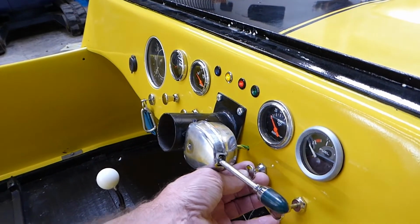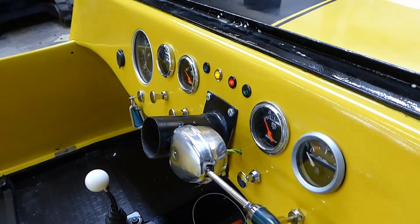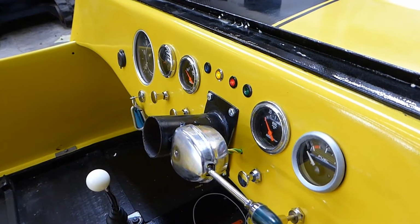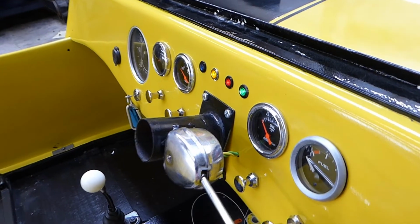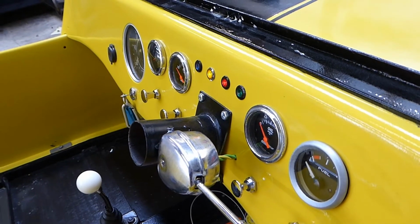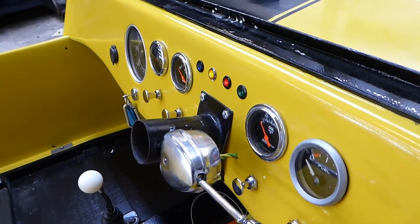The fuel pump: if I pull one pull, the back one goes, and the second pull, the front pump goes. It's supposed to be around the other way, so they're on relays. So the relay trigger feed, I just have to swap those over. The other one is the blinkers. They're actually going, but when I turn the blinkers around they go the wrong way. That one turns the right hand one on and that one turns the left hand one on. That's another one that just two pins under there, just plug them out, plug them in the other way.